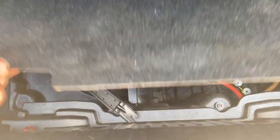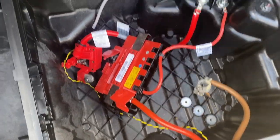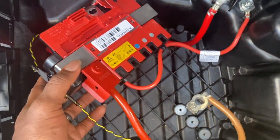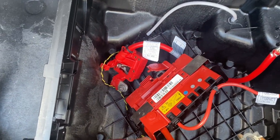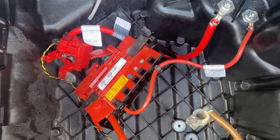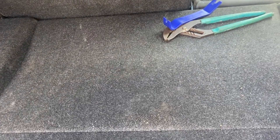Now I can get back to the battery. As you can see, all of this was disconnected. With all this disconnected, you can go ahead and use the jump starter cables in the front and try to jump it to turn it on. Now I'm just going to go ahead and release the driver's side seat so I can drop it down until I'm ready to replace the battery.